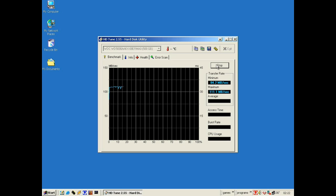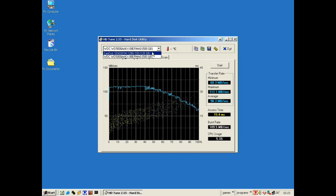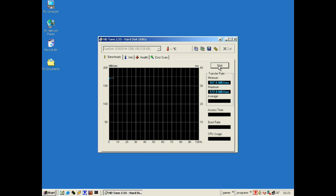Selecting the hard drive now — maximum is right now 111 megabytes per second. It's going to start dropping off toward the end since mechanical hard drives get slower the further in you get on the platters. After random access, we got 15.4 milliseconds access time and an average of 98 megabytes per second. Going back into settings to set the block size to 8 megabytes to max out the SSD's performance, as I think the chipset is the limiting factor.